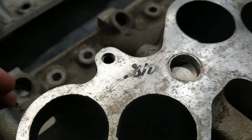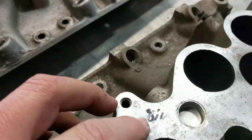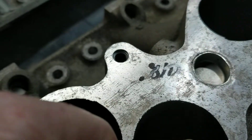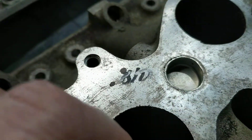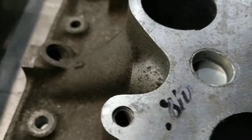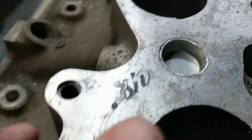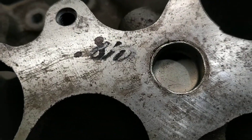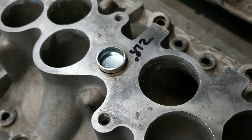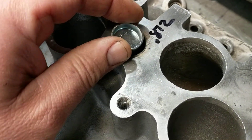Some have a hole that's about 0.81" — it's just cast, not machined, so it won't be precise, but that'll give you an idea of what you need. The smaller 0.81" hole uses a Dorman plug 555-0013. You can get them at O'Reilly's, AutoZone, Pep Boys — wherever. Just tell them that number.